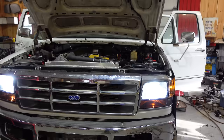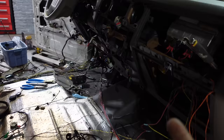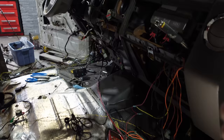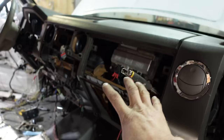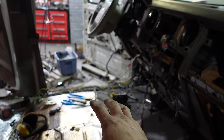My windows, keyless, and door locks all work properly, but I'm rearranging the wiring a little bit. The original wire I used for the door locks isn't a heavy enough gauge to pop the locks — that has to be a battery power. Originally I had a battery power coming through the firewall from the fuse panel under the hood, and I was going to use that to power my transmission. Instead I'm going to use that to power my door locks. The window key power wire is a heavy enough gauge, so I can use that and move it over.